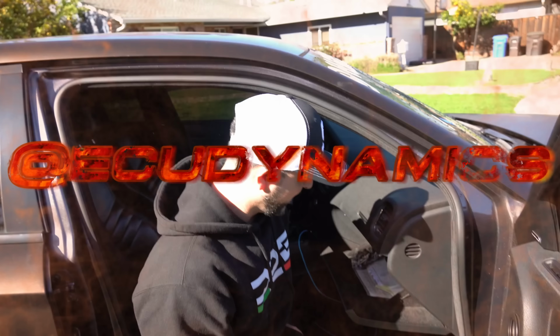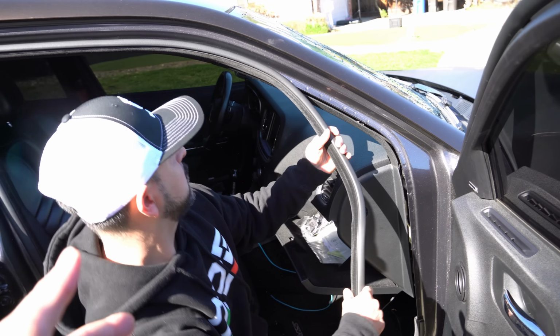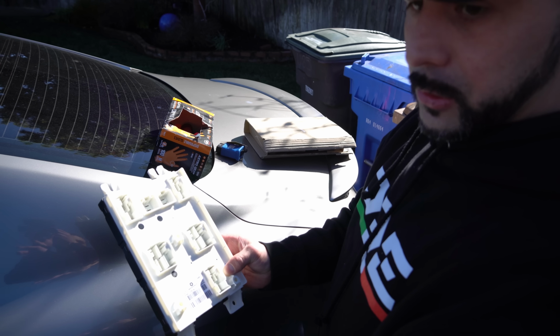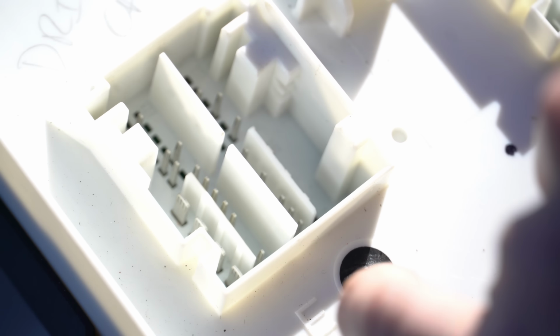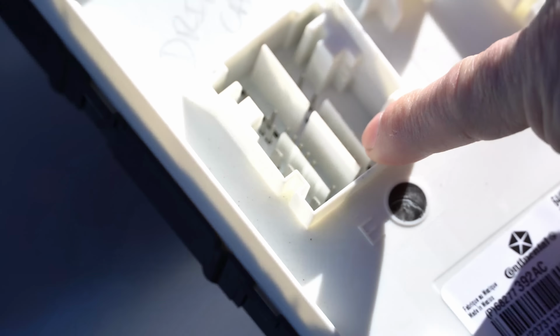We're back. What's up, man? How you guys doing? So explain the differences in BCMs. On the Charger BCM, pin E25, I believe, or 29. So it'd be 25, 26, 27, 28, 29. This is for your reverse signal switch to the backup camera.